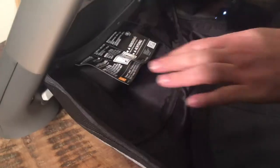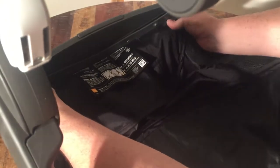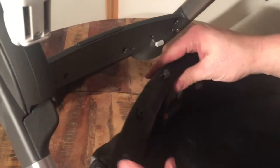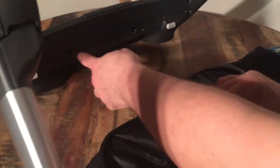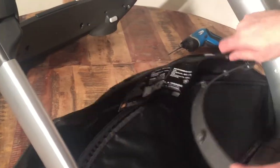There is this plastic rib which locks the shopping basket to the front end, and you want to grab kind of under the plastic rib and push up, because there are pegs that hold this in place into the front end. You can see there are two screw holes and the rest are peg points that slot downwards to hold it tightly into the front end. You can remove this plastic rib just by pulling it out.